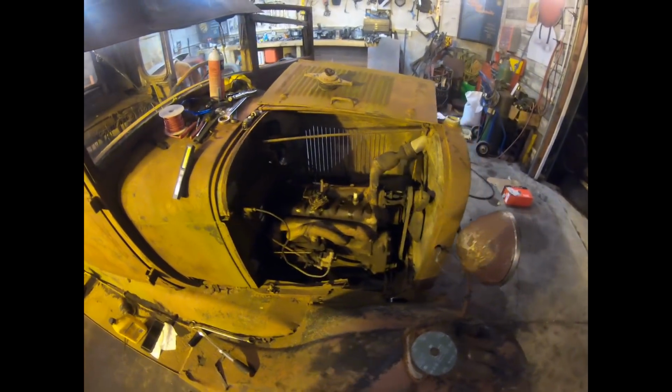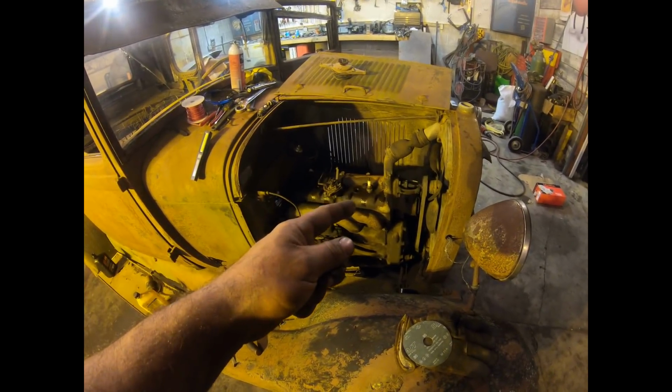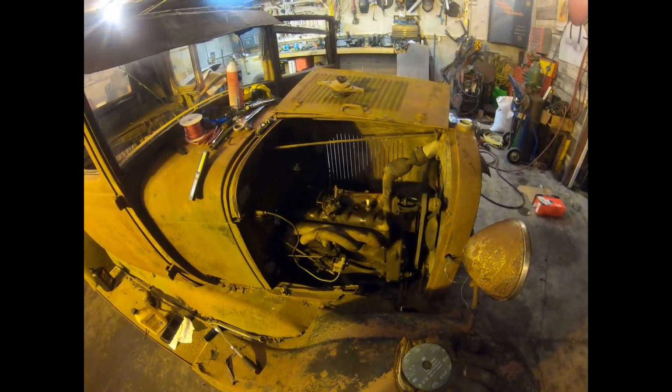So listen down by the exhaust. Yeah, definitely leaking down there when the piston's coming up, but you know what? We got 3 of them sealing really good. Maybe if we get it fired up and start sucking some fuel through, we might be able to clean out the rest of the debris under that exhaust valve in number 1.